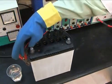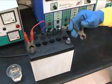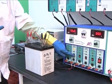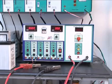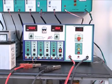If the battery passes all the tests, you may then place it on the charger for a long slow charge. It is important to know that most batteries on the market today have lead calcium plates in them, and when they get discharged down to a very low voltage they require a long slow recharge. Charge it for 24 hours.